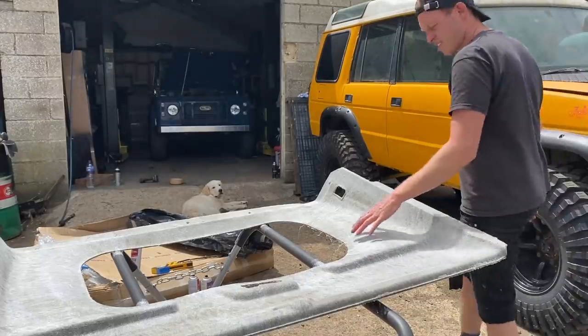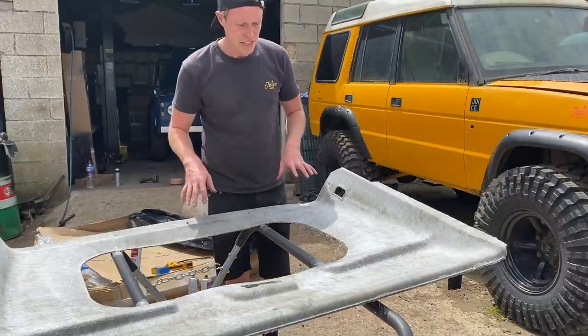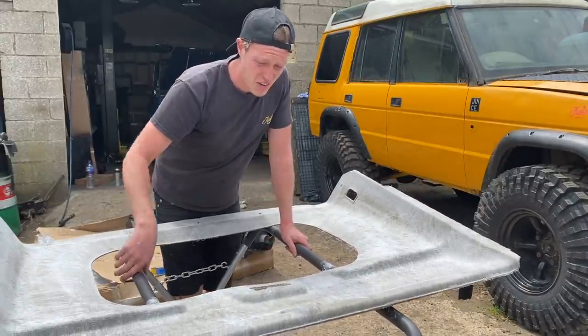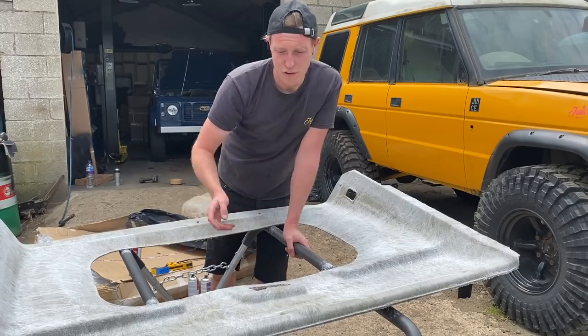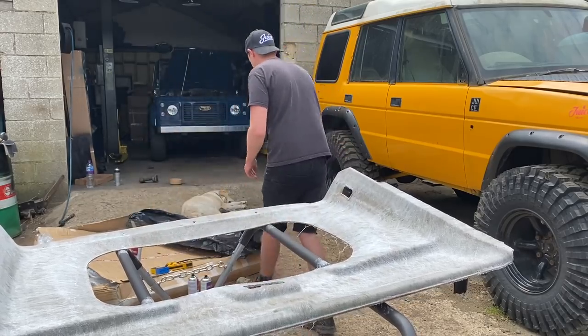Okay guys, so I'm just gonna wrap the headliner. Just what I have is grabbing some more base paint for the Green 90. The headliner before was covered in, well, the owners had smoked, as you know, and it was all falling off and it stank. So we just ripped the whole thing off and we're left with the original fiberboard. I've just given it a quick coat of the fast fix glue and gonna lay some Alcantara over it.